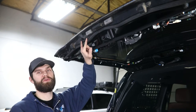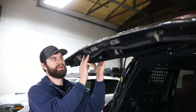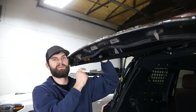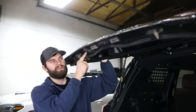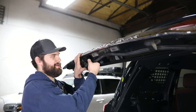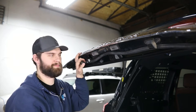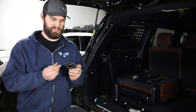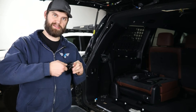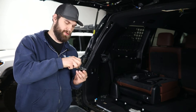At this point, the camera can be removed from the hatch using a T30 Torx. After you have these two bolts out, you're going to need to come on the inside of the hatch — each of these little nut clips has two tabs that need to be pressed in, allowing you to pop them out of the hatch. Once you get both of those clip nuts out, there's just a little thumb tab on this harness connection here. Press that down while pulling the harness back to release the camera. Now the camera can be removed from its mounting bracket using a small Phillips head screwdriver — there are two screws in the back holding it in place.